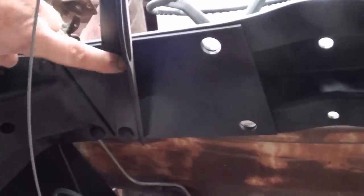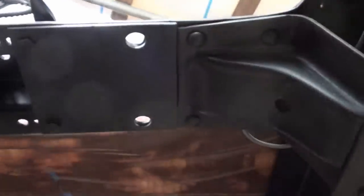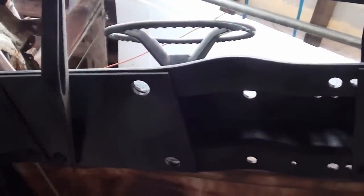Now in your 1955-59 Chevrolet GMC truck, these plates are added to the crossmember. And if it's riveted in, then you'll know you have a factory installed unit. If it's bolted in, then you'll know that it was an aftermarket. This, however, has both riveted and bolted. So what that means I don't really know, but it had to be riveted in at the factory.